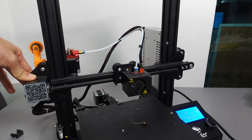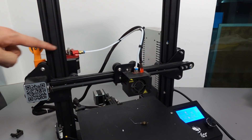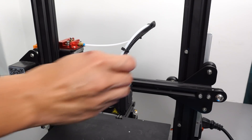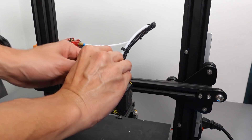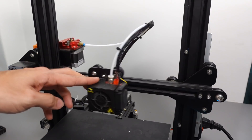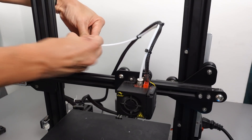Next, we're going to lower down the print head so that we can get to the Bowden tube easily, to remove the coupling and replace the Bowden tube. We will start by removing the clips that are holding on to the pneumatic coupler — a bigger one for the hot end, and a smaller one for the extruder end.